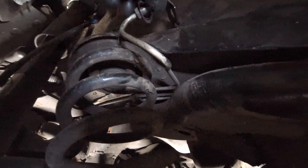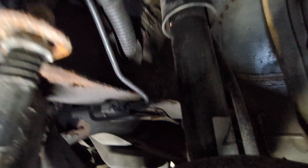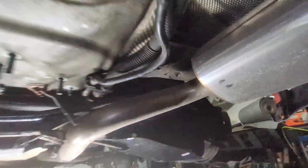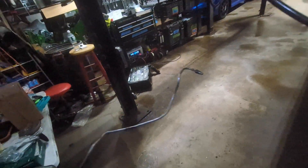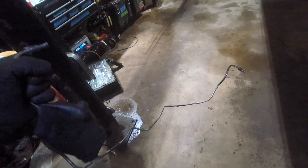You can see on that side the line just runs over here — I just popped it out of the plastic. You can see it on the side here going over the subframe. After a lot of wrestling, I was able to bend the line and get it out over. I actually got it from the control arm side, pulling towards the front and putting it out this way. It doesn't have the original shape — I had to bend that section quite a bit. But that's doable. If you don't want to drop the strut, you can still remove the rear line.